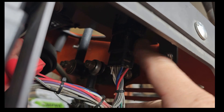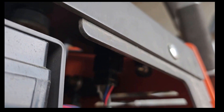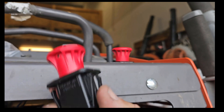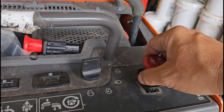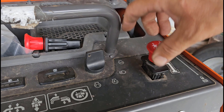Here is the bottom of the PTO, and I'll show you on the new one too. On the PTO there are these squeeze clamps - that's how it inserts. I'm just going to squeeze the clamps, pull it up through there, then connect it, rewire it, and run it back down. I squeezed the clamps with one hand under there and my other hand over here, just pulled up on the PTO switch - and that's how I brought it through. Now I'll just pull it out of the socket and punch the new one in.